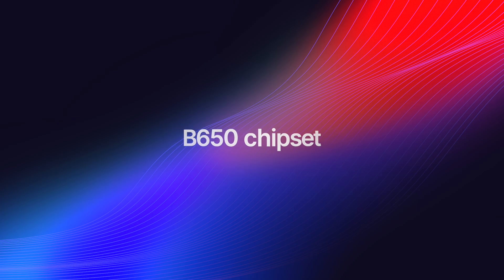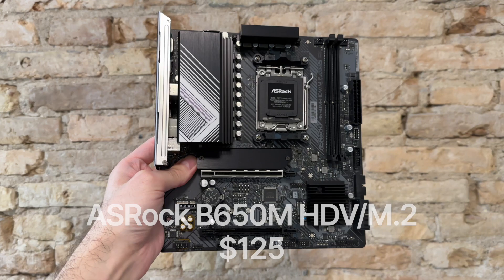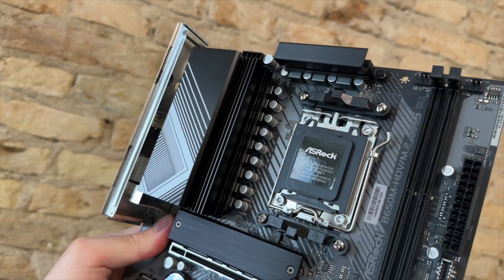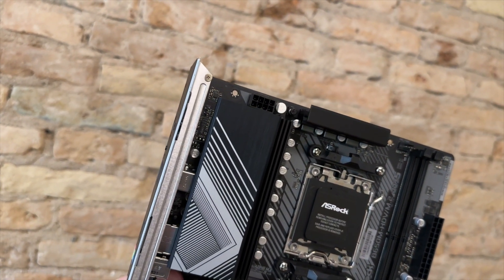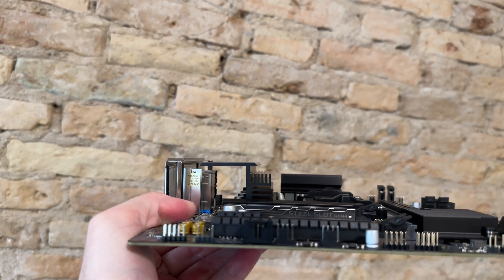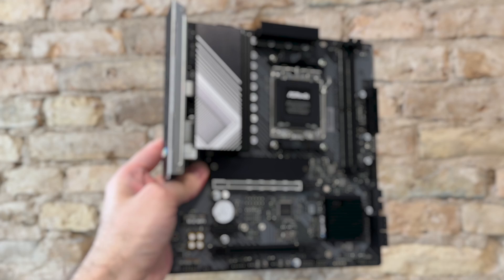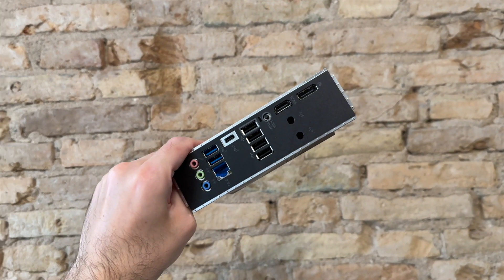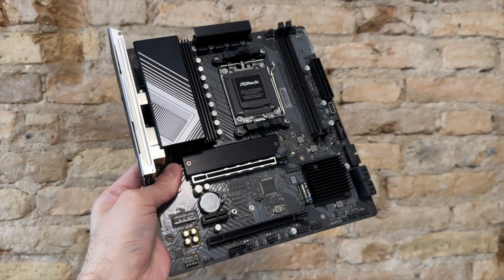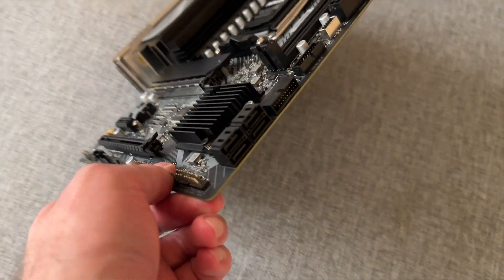Let's take a closer look at the regular B650 first. In this category, the ASRock B650M HDV M.2 is the best value motherboard, currently priced at $125. I recommend choosing it over anything else at this price, because it features an 8+2+1 power design that can handle even the most power-hungry Ryzen 9 7950X at full load all day long. There is no thermal throttling — the VRM stayed relatively cool at around 80 degrees during a one-hour Cinebench stress test. The B650M HDV M.2 is packed full of features, including 2.5GB LAN, 7 USB ports, a Gen 5 M.2 NVMe SSD slot for the fastest SSDs currently available, and a second Gen 4 M.2 SSD slot, which is still very fast and much more affordable.